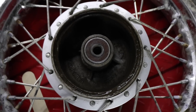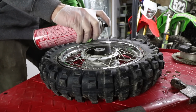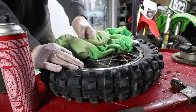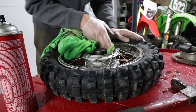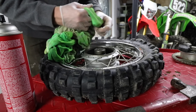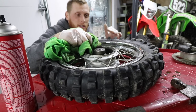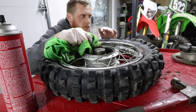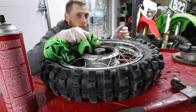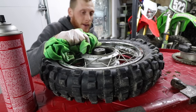She's caked in there. I've always heard this stuff is good to breathe, so I'm going to try to take as much in as possible — just kidding, airborne brake dust is not good for you. For the longest time I was getting frustrated with the brakes on this thing. I did change the pads a few years ago but it's completely filthy in here — that's probably why I looped out a while back with the Two Brothers brake lever. There's just not enough clean surface in here to get any bite with the shoes.